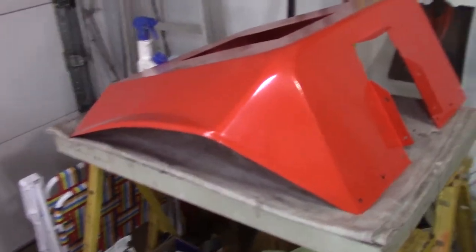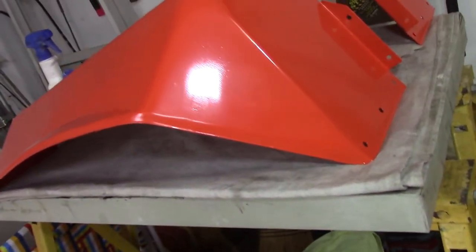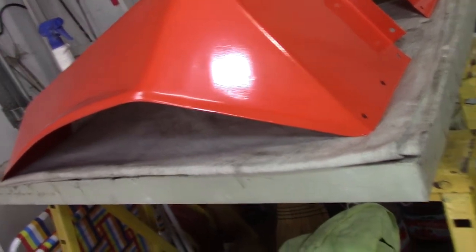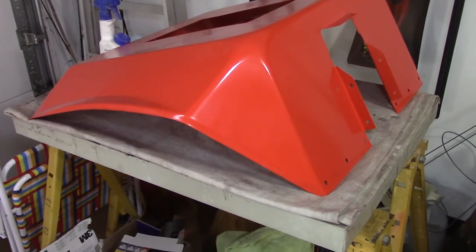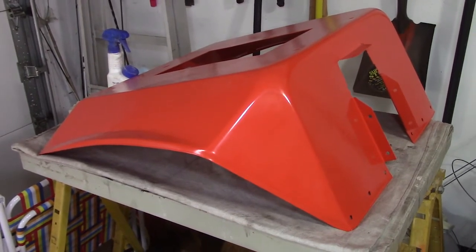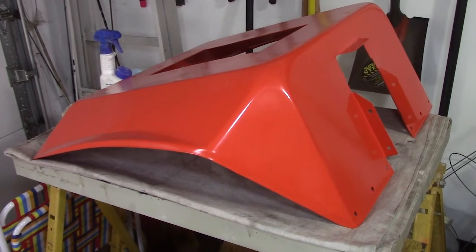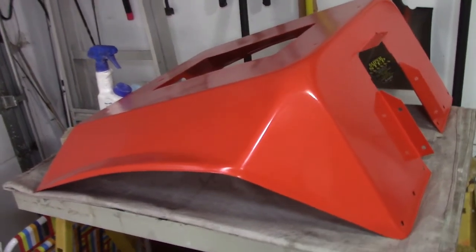This finish over here I kind of rushed on, and there are some spots you can see — slight imperfections — and it's driving me nuts. So I'm going to sand those spots and try to get this at least as good as the hood is right now, then go from there. Once again, here go some more hours of sanding, putting in filler, and painting.